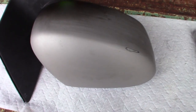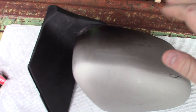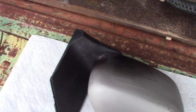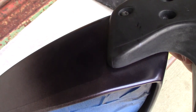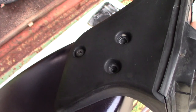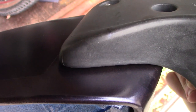After I wet sanded, the next thing I did was use a tack cloth to remove any residual dust or anything like that, and then I shot around these areas here. I let that dry to the touch and then screwed the pedestal back on, so that we have really good paint down in there and no horrible tape lines that are going to flake later in the future.